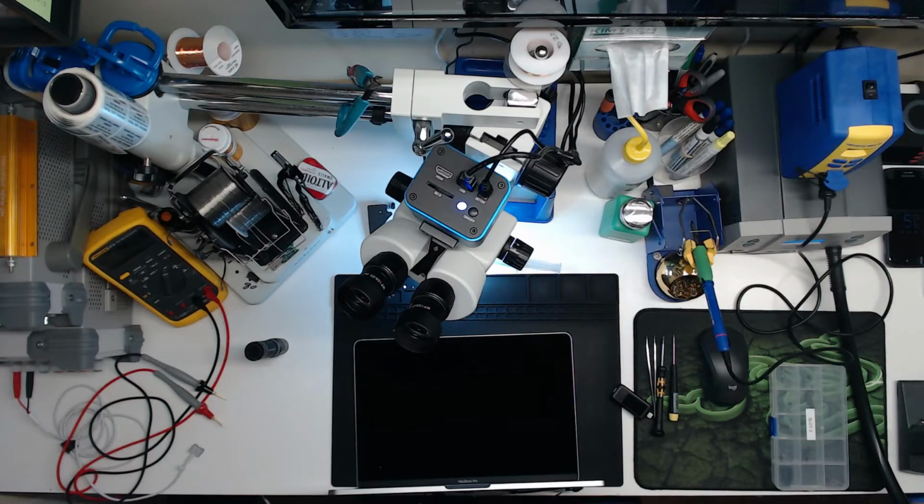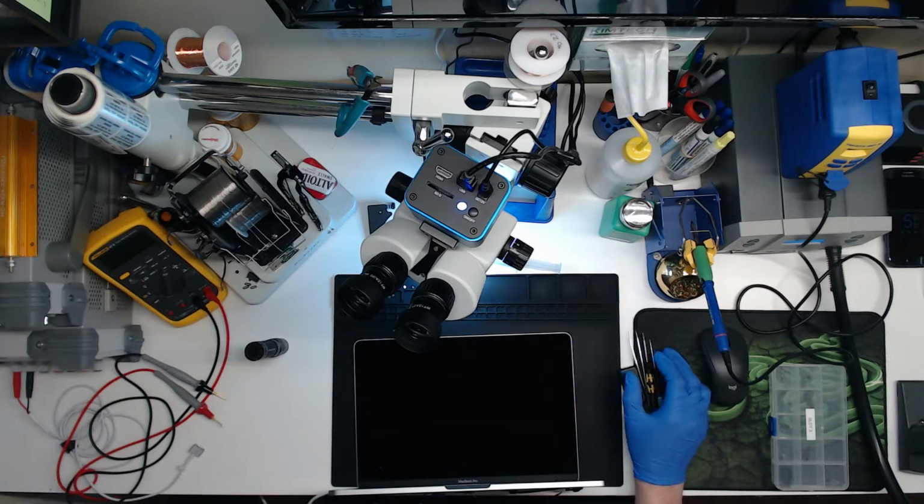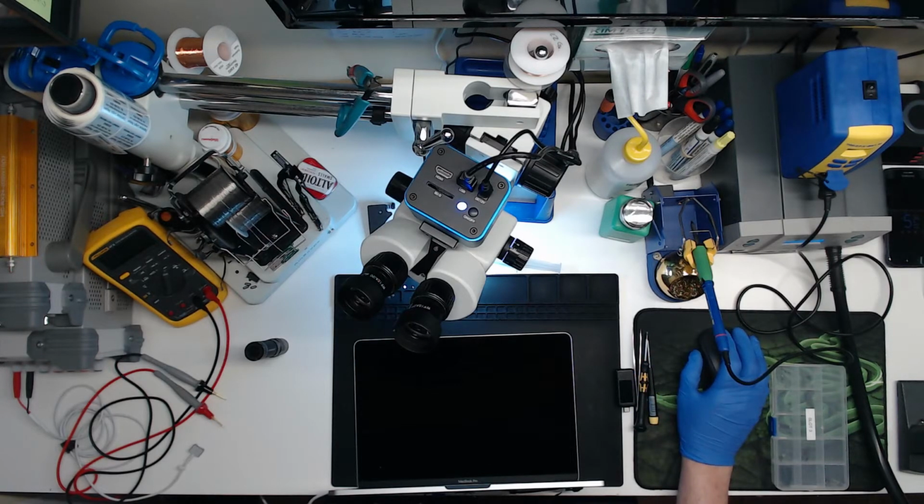And if I happen to get something on the external screen, I will switch over and show you. I'm gonna try it first real quick and see. Just trying to get an image on this board. That's why I plugged in the speaker so I can hear it chime. So there's our chime. Apple logo. So we have an Apple logo. So the board works.